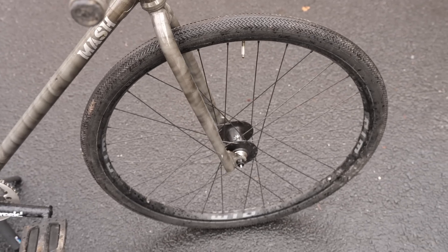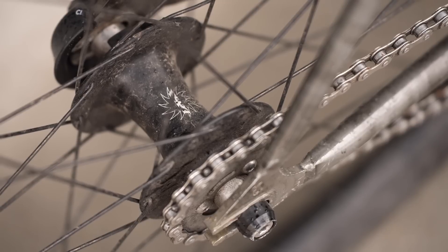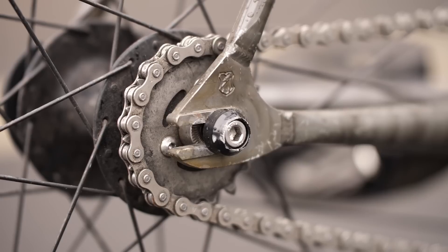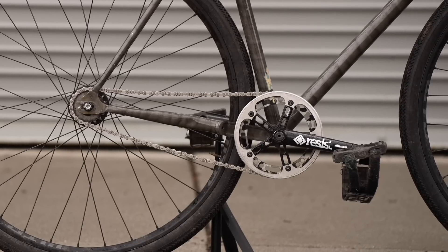For wheels, I'm running the WTB I-Tough rims laced up to Level hubs. Level hubs are a really cool direct drive hub system - I made a whole video about it, link in the description. For gear ratio on this bike, I'm running 43/17, which sounds easy, but with the larger tires it's still easy, though not as easy as comparing it directly to say a 23C 700 build. I built this up for doing tricks and just being a nice all-around bike, so it is on the easier side.